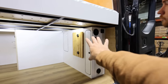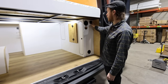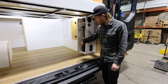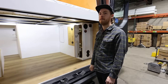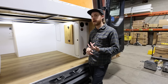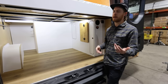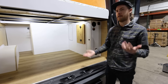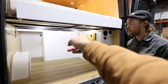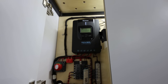The rear panel houses the outdoor shower setup: a Kuss water gauge, a fill port, overhead lights switch, water pump, and a quick-connect spray port. Under a small door is storage for shower hoses. Hot water is available — options include a portable propane unit, an electric unit, or an engine-coolant-heated unit; the right choice depends on the customer's demand and power consumption preferences. There's also a small cubby in the back for the solar controller and fuse box.